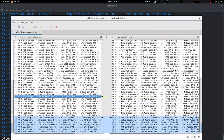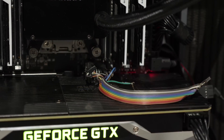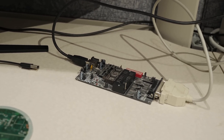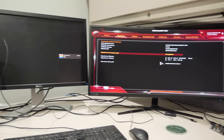So how do you do it? How does it work? What do you have to do? When you put in the Thunderbolt card, you get an extra PCIe bridge that shows up in your system immediately, but it lacks any kind of initialization code. There's a PCIe bridge on the AMD side that's going to bridge to the Thunderbolt bus interface on the Intel Alpine Ridge side, but there's a little bit of software missing to make the two of them talk to one another. Obviously I'm not going to write that software, but that software exists on Intel systems — and it turns out it lives in the UEFI. There's a UEFI module you can extract from Intel systems if you know what you're doing and inject into a Threadripper system. But that still didn't quite 100% work, because the Thunderbolt card and related accoutrements also require firmware. So you'll need to set up the card in another system first, make sure the firmware is all initialized, and then take that and set it up in your Threadripper system.